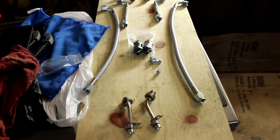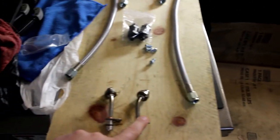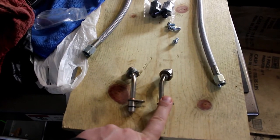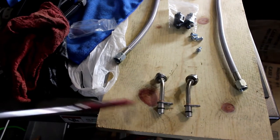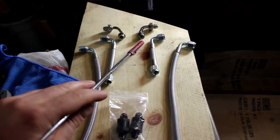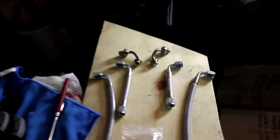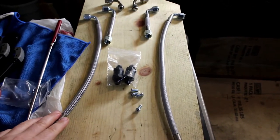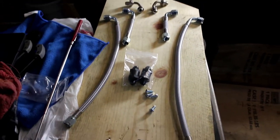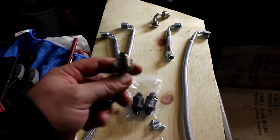In the next part we're going to put in our upper oil lines. Since we're not using the stock units, we're replacing them with the serviceable oil line kit from JHM. I laid out the components as they go in the car. Once you push the tabs down, the right side points to the right, the left side points to the left. The left outside line is shorter than the right, and the left inside line is longer than the driver side. I'm going to put on the upper oil fitting line now.